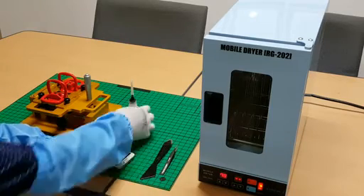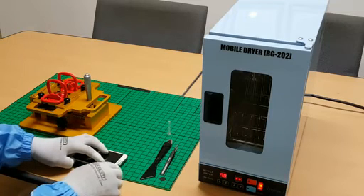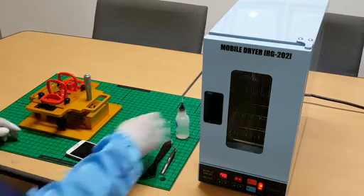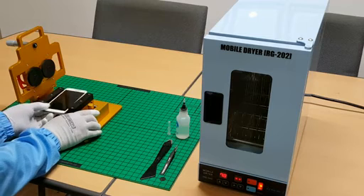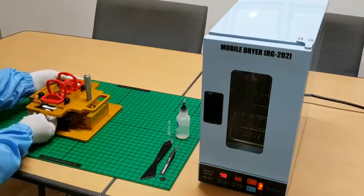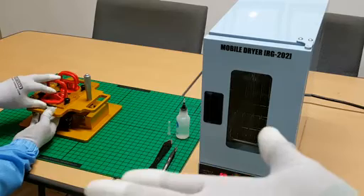The user wears a protective anti-ESD glove and pours the material alcohol. Note that too-strong alcohol is not recommended. Use suitable material alcohol to reduce stickiness, because alcohol is very volatile — when you pour it, it will soon vaporize. Open the upper frame of the LCD disassembler jig, adjust the knob, cover the upper frame, place the smartphone upward, and then adjust the suction load.